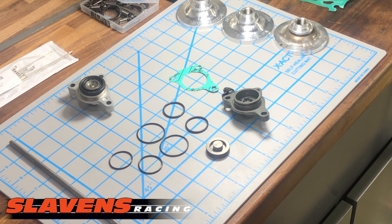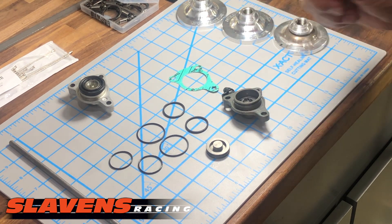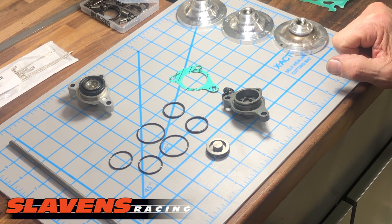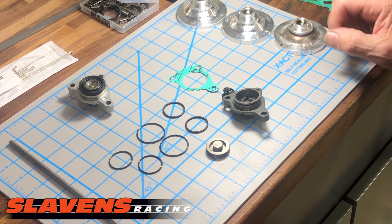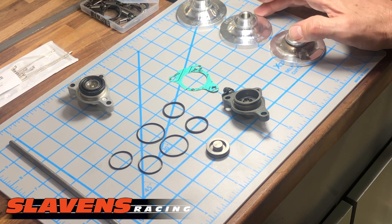So just to review: if you go out to your garage and pull in your clutch lever — it's kind of a natural habit we all have — and it pulls in super easy, you'll know instantly that you've got a problem, especially if you try to stick it in gear. This piece down here has failed and the fluid has leaked into your motor oil. I do recommend that you change the motor oil at that point. Obviously if you're out on a trip it's not as big of a deal — you can continue to ride it, but change it whenever you can.